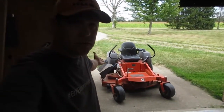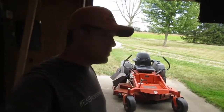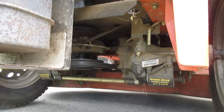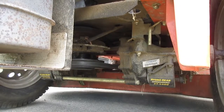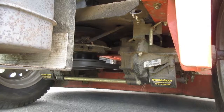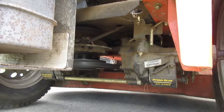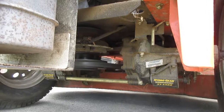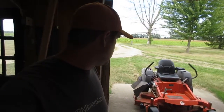Today I'm going to show you how to change the belt on this zero turn lawnmower. It's gotten to the point where I can start the mower deck up, it takes a little while for the blades to start spinning, and then as we go through thick grass it bogs down. I've never changed the belt in seven years or so, and the belt feels pretty sloppy, so we picked up a new belt today.